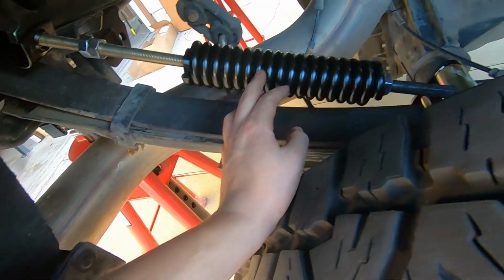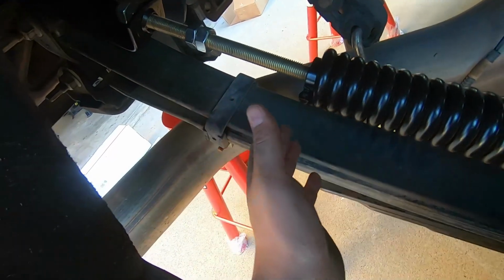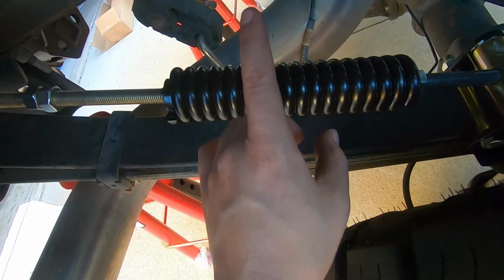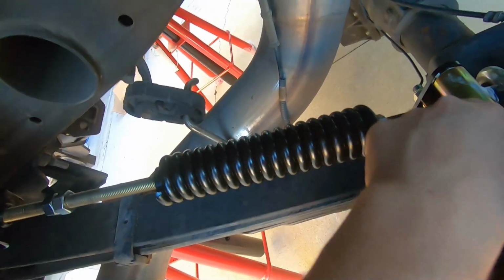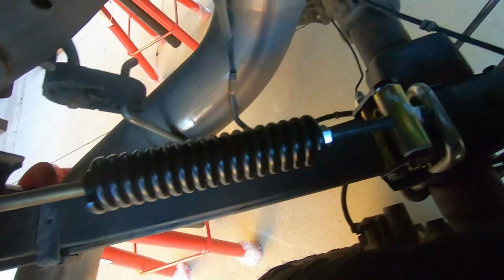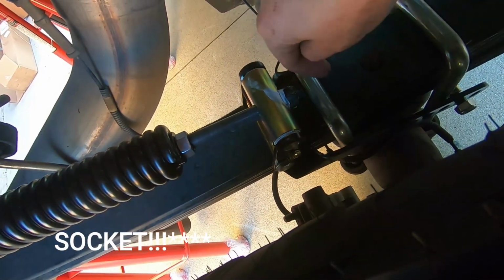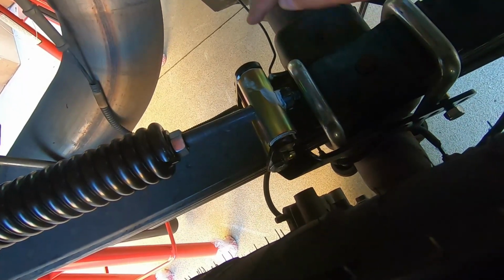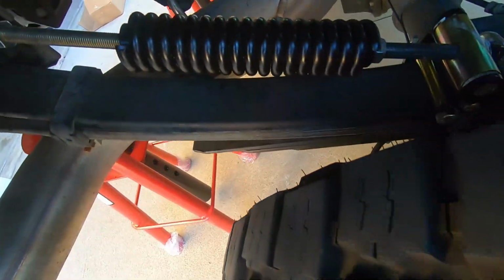What you're gonna do is keep tightening this, which you need to hold in place, or mine's actually, there's enough tension on this bolt that it's holding it. And you're gonna do it the non-instructional way, forearm workout. You're gonna just tighten it, because you're noticing it's tightening from here, that rod's turning, and then down here. So anyways, the right way to do it is get a tool, put it on right here, which is our 14 millimeter. The U-bolt's in the way. Can't use a ratchet because of the way it's pointing. So we're gonna put on a ratcheting wrench and get some tension on it. And then keep tightening it, keep checking with the feeler gauges to see where we're at, and then I'll show you the rest. It's pretty simple.